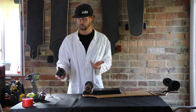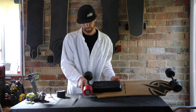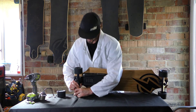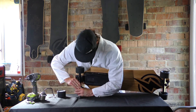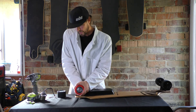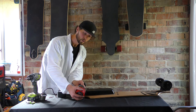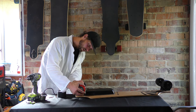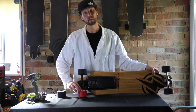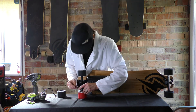This is the part you're going to be replacing. If you have a new rotor, you pop it on — you're probably not getting a red one, but just in case. Then you need to line up the holes. Twist it until the holes are lined up. If it's not lining up and you can't twist it, take it off and re-seat it, making sure you're close to aligned before pressing it all the way in. Once the urethane grips the outer ring of the stator it gets harder to twist. Right now my holes are lined up and you go back and put all the screws in.